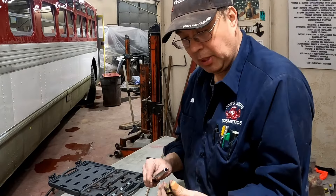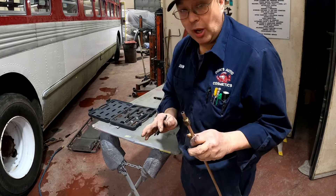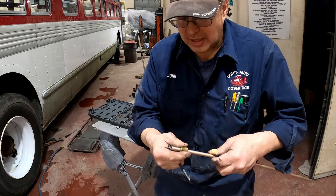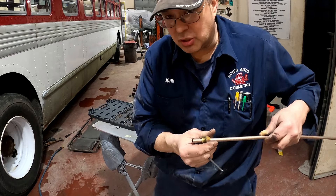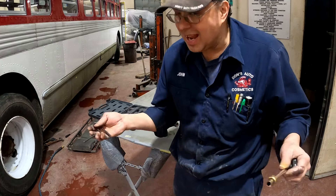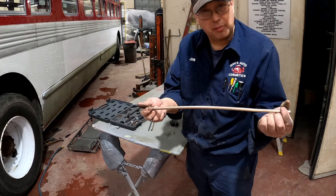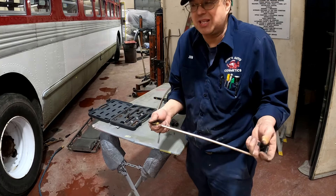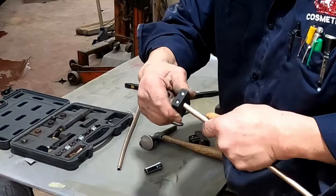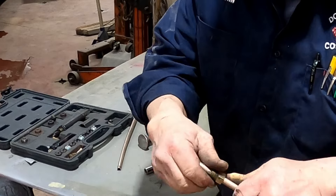I'm going to double check my flare to make sure it fits this line, and it does. Here's a pro tip: don't be in a rush. Second guess everything. Make sure that the brass fitting you'll be using is facing the right way so it screws in after you make the flare. You wouldn't believe how many times in 45 years I put this thing on backwards. The second tip: don't forget to put this on. Sometimes you can cheat and put it on after — a lot of times it's not a cheat, it's a save. Just don't be in a rush, take your time. Wait! Put the brass fitting on first.